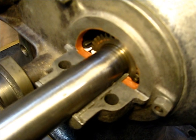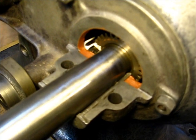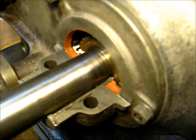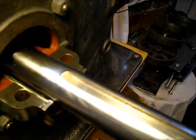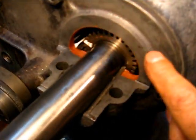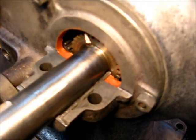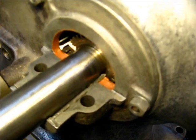Those two teeth are marked and this tooth is marked. With the white highlight, they're easy to see on this side. If you turn it all the way around and look into the crankcase on the other side, the teeth on that side will be marked and this one won't. Set this timing right here and you will have a very happy engine.